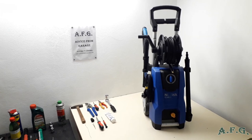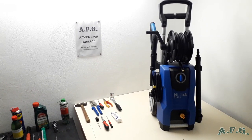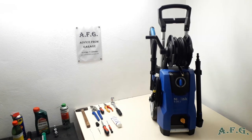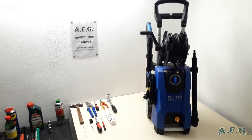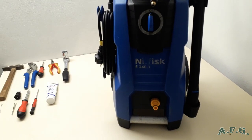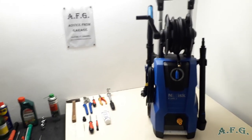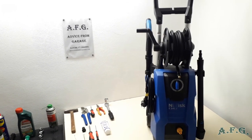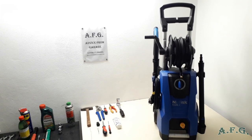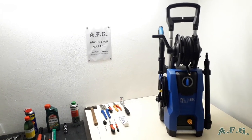Welcome, watching another tutorial. We have successfully finished tutorials on how to repair Karcher HD5/15C and Nilfisk C131. And this time we focus on another Nilfisk hobby class machine, and it's Nilfisk E140.3. What we will repair is the following. We will replace oil seals, water seals, we will replace the start-stop ventil, we will show you how to remove and replace the non-return valve and a few more things like o-rings, etc.